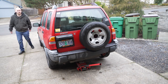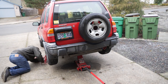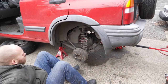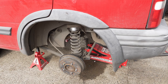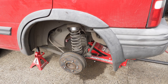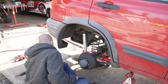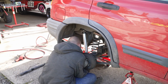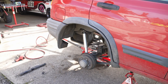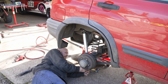I decided to start with the rear first, given that it's a much more straightforward process. I simply need to jack up the rear axle, disconnect the shocks, lower the axle back down releasing the coil springs, then seat the spacers onto the spring perch, reinstall the springs, and jack the axle back up into place. I also had to purchase shocks 2 inches longer than factory to allow for extra travel so the shocks wouldn't bottom out when fully articulated. After studying specs, I ended up ordering KYB shocks for the rear of a 2-wheel drive Toyota Tacoma — they have the same top and bottom mounts as the Suzuki but are 2 inches longer.